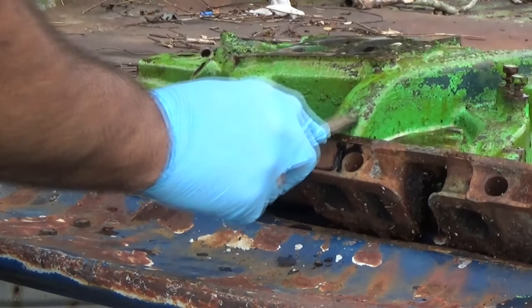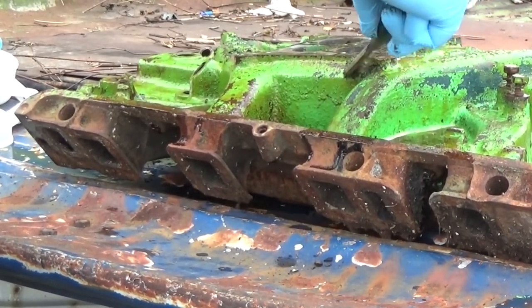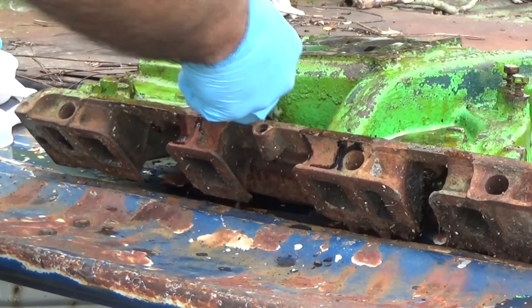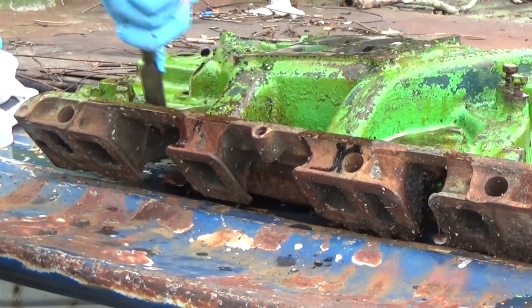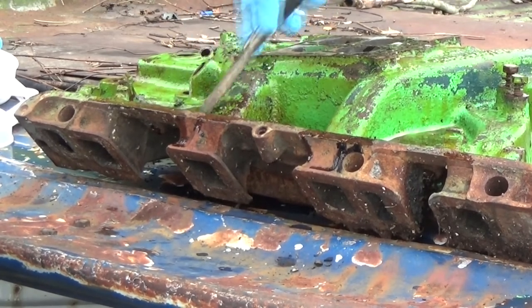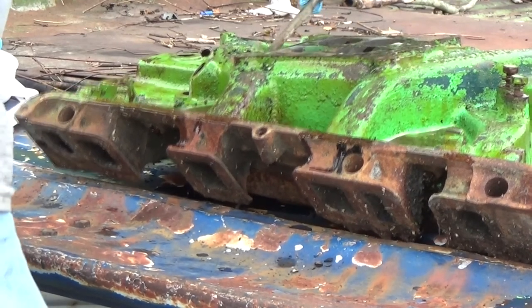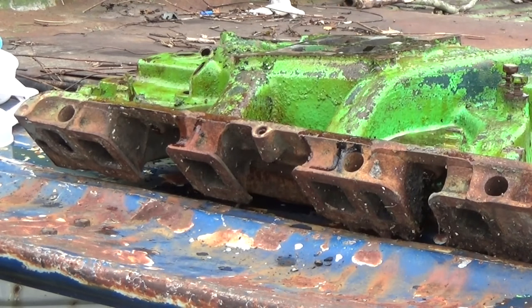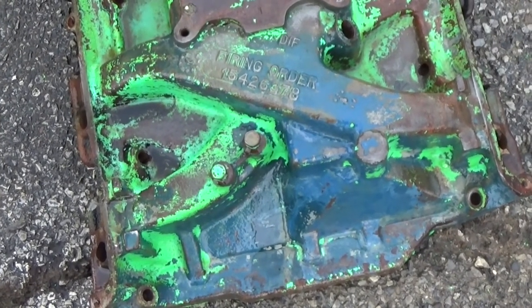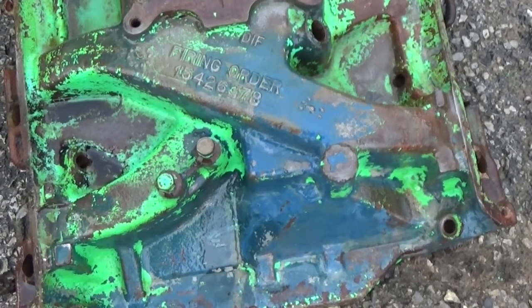Okay, it'll probably take two or three times. I don't like to sandblast intakes because that sand can get into places that you may not get washed out. The places where I got that mixture on - just run a brush across it and it brought all the green paint off. It works pretty decent if you can just get a brush to it. It softens it up before it'll come off. I wouldn't want to make you stand here and watch all of it, but it does work.